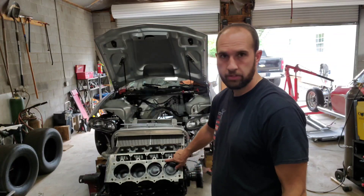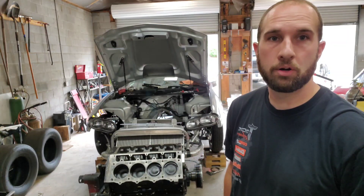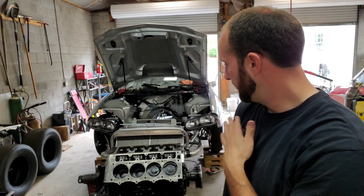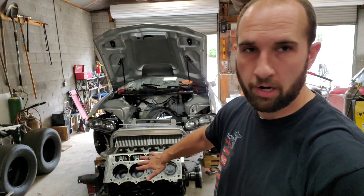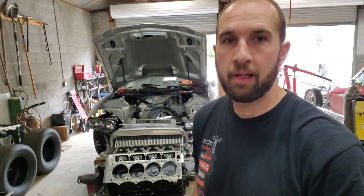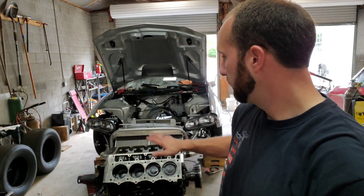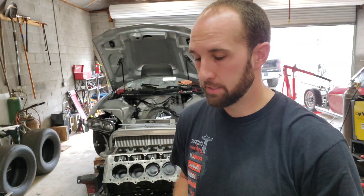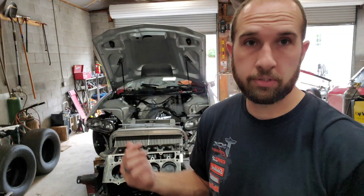We've got all the surfaces of the water jackets full of epoxy, and I just kind of took the top of that epoxy off. We're going to deck this block so it'll be perfectly flat. We've got water flowing in the front of the block and out the side of it, so all the sugar is out from under that epoxy. It's ready to be decked, and then we'll be good to go. I'm ready to get the heads done.